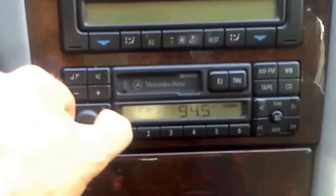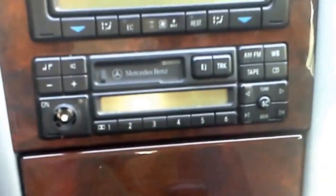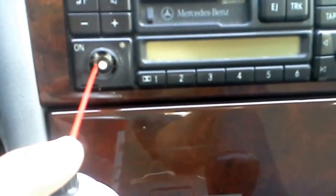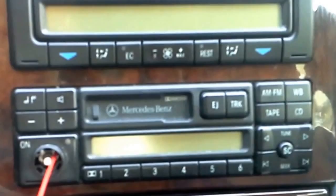Make sure you put the straw on. Pull the knob off the radio like that. Make sure the radio is turned off, and just squirt a couple — three or four squirts — into the dial and along the edge of the dial.